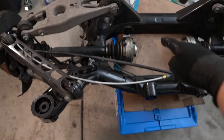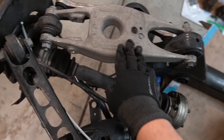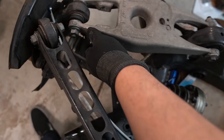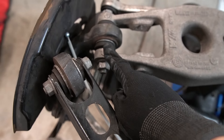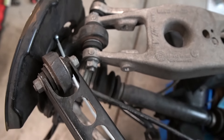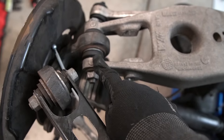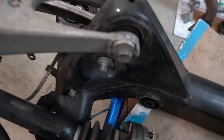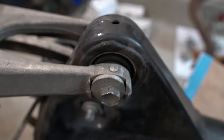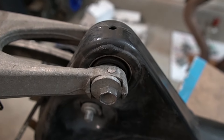This is the front, this is the rear, and it's upside down. For this control arm here that holds the spring, the outer ball joint right here is a sealed ball joint and it's pretty stout. This car only has 40,000 miles on it, so I'm not going to bother replacing this one because I don't think it's going to make that much of a difference. But the inner one right here is just a simple rubber bushing, so I want to push this out and replace it with an SPL part.